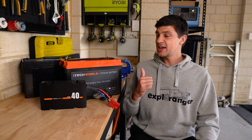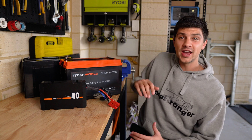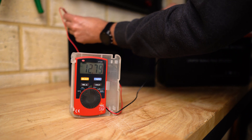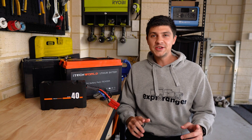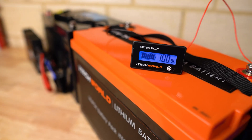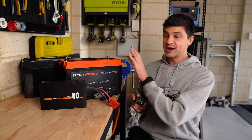Point number seven is how we keep an eye on charge level. For AGM batteries, the voltage varies a lot as we drain them, so you can use a cheap volt gauge from eBay or a multimeter, with 12.8 volts being full and 12.05 volts being empty — technically 50%, but that's empty for AGM. Lithium will read 13 volts all day long because there's nowhere near as much variance in voltage as we use the charge. So most people get a battery monitor and a shunt, which are more expensive and more complicated to install. However, I recently picked up a new style of volt gauge designed to work with Lithium batteries — it picks up on those small variances within the 13 volt range and delivers that as a battery percentage. I've only used it for a couple of trips, but it seems to work pretty well and gives me a cheaper option for a rough idea on battery level.